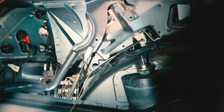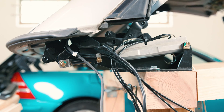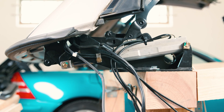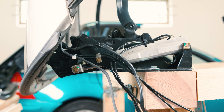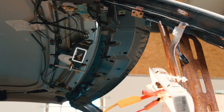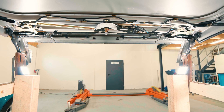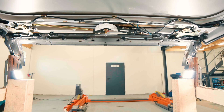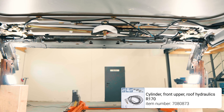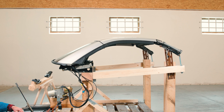We recommend using a support to secure the partially open roof. Now let's discuss the interaction between hydraulics, mechanics and electronics. We started the roof opening with a view of the trunk interior, focusing on movements in the front roof section. We'll refer to the hydraulic cylinders at the C-pillar main hinge next to the parcel shelf as the main cylinders. The rearmost cylinders in the trunk are the trunk lid cylinders, and the cylinder in the upper roof section is the cross cylinder. Our degree scale helps during tests — if the lever points in the driving direction or at 90 degrees, the rotary latches are locked, the roof is closed, and the end position switches are activated.